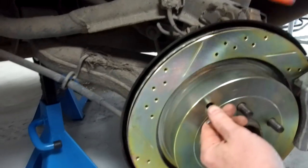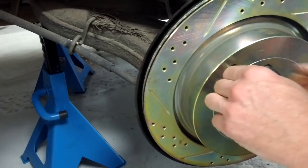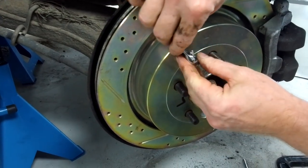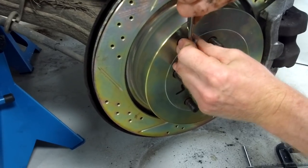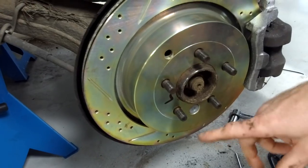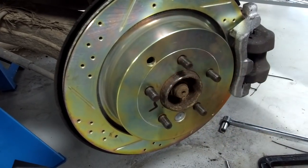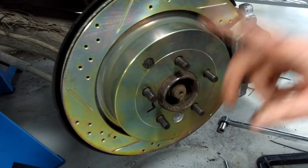So now it's tensioned up. Rubber mallet, give it a tap. And then just tighten that up again now. That's taken up all the slack. I don't think that needs to be super tight, because that will continue to take up the slack. But he does say tighten it up, though, doesn't he? Yeah. I don't think you want it vibrating loose, and you don't want that little wedge and the screw falling out. So put your rubber thing back in, and that should be your brake adjustment done.